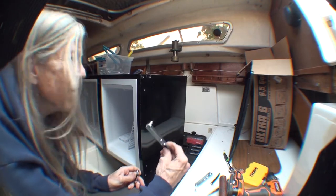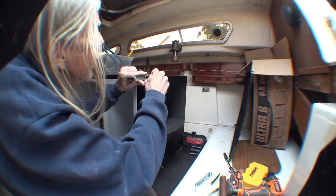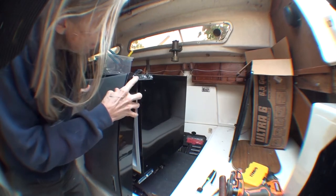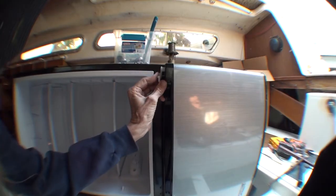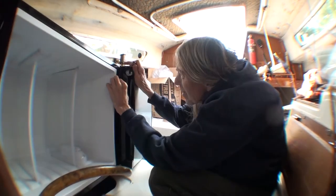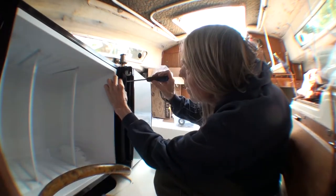In this case, the one I just took off the bottom I'll now put on the top, and start the reassembly of my refrigerator. With the top hinge pin in place, I can put the freezer door on, and then the middle hinge pieces. Once I get the freezer door aligned, those hinge pieces will be in the correct position.